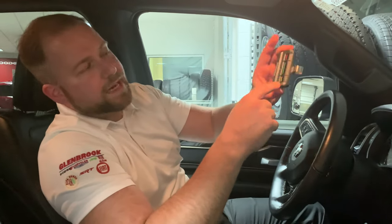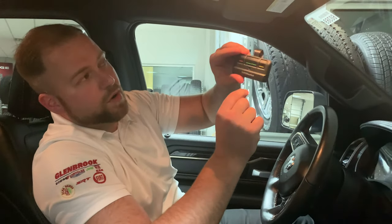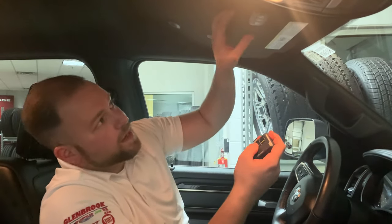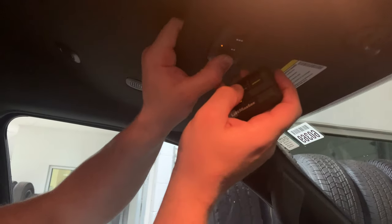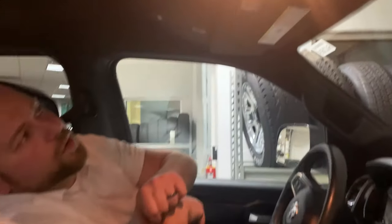The next step is you get your garage door opener. You can program up to three different devices — three different garage doors, or it might be a gate or whatever you have the opener programmed for. So one, two, or three devices. You take whatever button opens the device you're programming, pick whatever button you want to program it to, and press them both at the same time and hold them. You'll notice it blinking slowly; hold it until it blinks rapidly. At that point you know it's programmed, and you'll be able to use it to open and close whatever garage door or gate you have it programmed for.